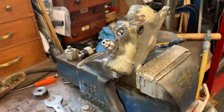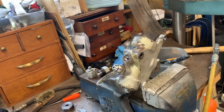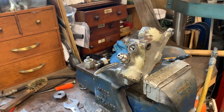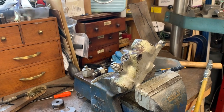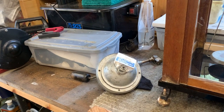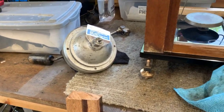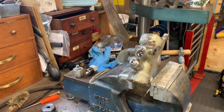I didn't find anything wrong inside here — the big spring in the bottom, which is actually bigger than a valve spring on a Mini, looks fine. I think the reason I only had four or five pushes before the warning light came on was the accumulator itself. It doesn't look that new — looks like someone's painted it — so I'm not going to mess around. I'm going to replace it, and probably do the back one as well. That's it for now.